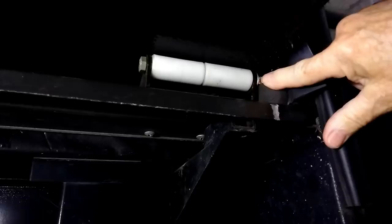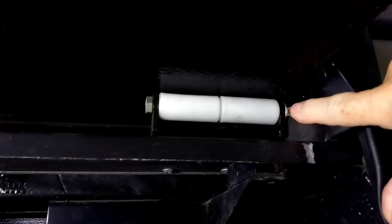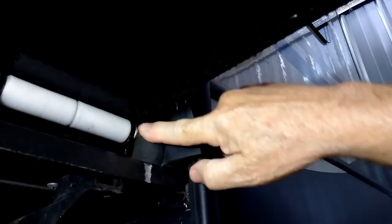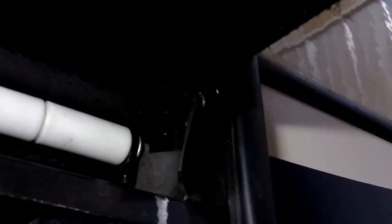Here's the design flaw we've been talking about. You can see right up in here — they have a nut on the end of this bolt that holds these rollers on. That nut doesn't really have a washer on it; it has a built-in washer. And that washer is too big. What happens is — you can see it — it's all frayed up in here. As it rolls in and out, it's fraying this material right along through here. You can see it's all frayed right next to where that washer is, and it's tearing it up as the slide goes in and out.